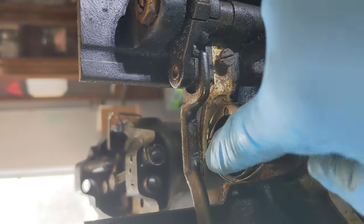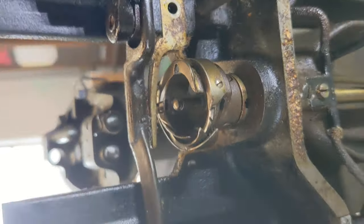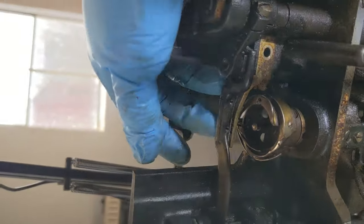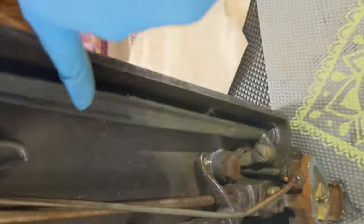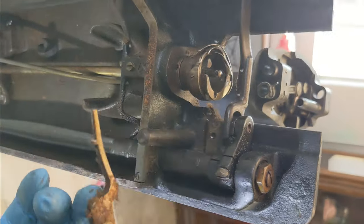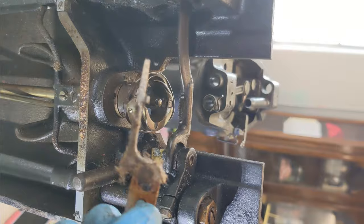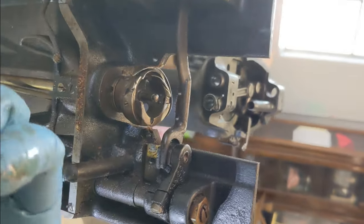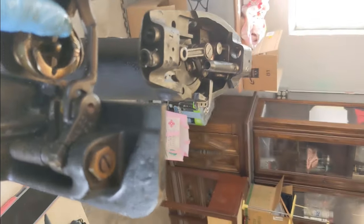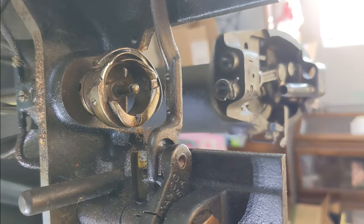There is a little piece right here that looks like it's blocking that race in. So I've loosened up this screw and I'm going to see if I can get this piece out. This piece just popped off — it was welded in there with glue. This is where it was: just one screw holding it in, and this little nub right there. You can see it's angled up just a little bit. That little nub is what is fitting right here in the bobbin case. I'm hopeful that that might loosen things up for me.